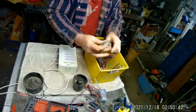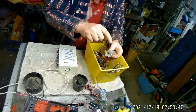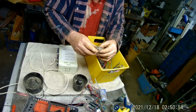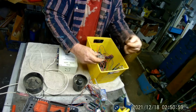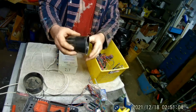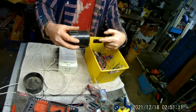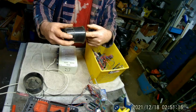See, this has a little piece on a spring. The piece on the spring is connected down here to the board. Over here is another piece. The piece on a spring has a little point on it, something like a cone, and the pointy piece goes into the cone, but it doesn't touch it. But this is on a spring, so if you jar the car, the spring moves and it touches this, and it sets the alarm off.